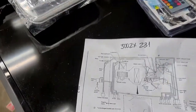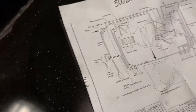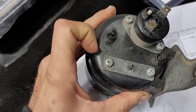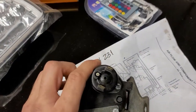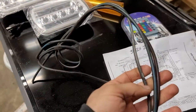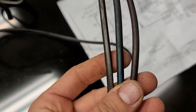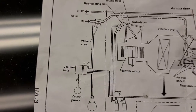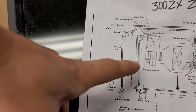This item is called the vacuum tank or vacuum pump. You got three lines coming out of it — you got this one that says M, you got another one saying F which goes here, and you got one where you have a positive and negative connection. I already removed the hoses, so you got a couple of colors here: black and white, black and blue, and black and red. If we look at this diagram, you can see that the one that says SV8 is the one that goes here.